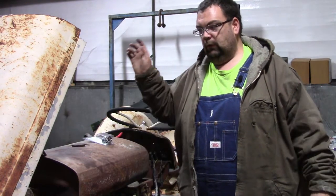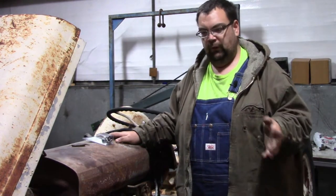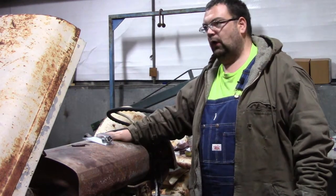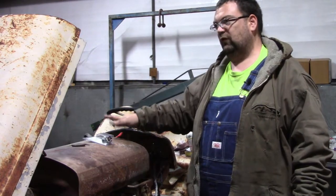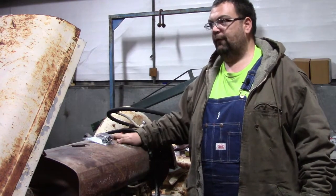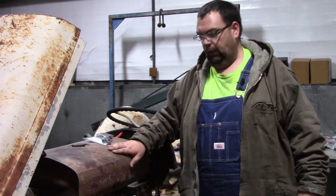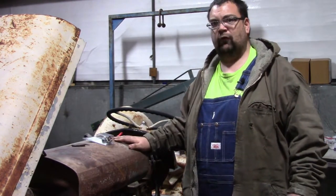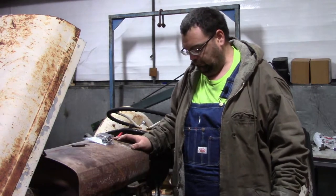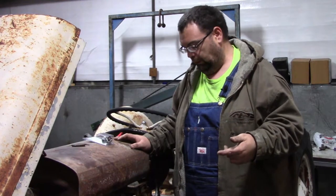But let's get back to the little Fergie here. For you guys that don't follow me, and maybe don't follow my brother over at Crazy D, we have been trying to get this little thing to run. We've had some success. It will putter but won't start. The first time we tried that, the starter broke, and you've had the video on how to fix that. And then I was having starter problems. I didn't get some stuff quite right when I put it back together. It was dragging, so it wouldn't let us get enough rotation to get it to fire.